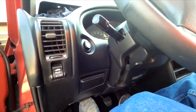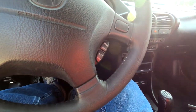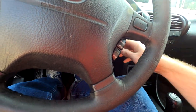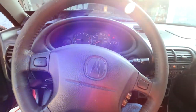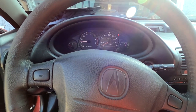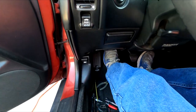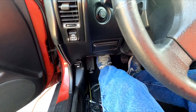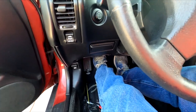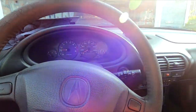The main importance you want to pay attention to — I want to demonstrate this. I put a chock behind the rear tire so I'm not going to go all the way. Pretty much, make sure that when you put it in gear it's not going to drag. Just let it out until you get the engagement point. Pretty much you just want to play with it, and I've got to road test it as well to make sure when you release the clutch from the gear it's not going to drag.